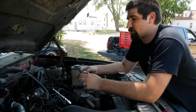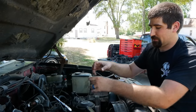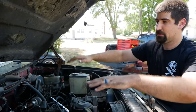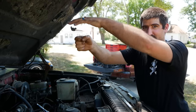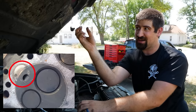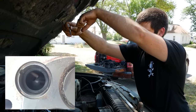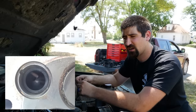The big thing on these trucks, the reason they require glow plugs, even in 90 degree temperatures, is there's a pre-cup that sits just above the chamber. They're not like a traditional engine with a piston and combustion chamber. They are piston, cylinder head, and then there's a hole drilled in the cylinder head where a combustion cup is pressed in and a little hole sits. You'll put the tip of your glow plug in and have your injector shooting right beside that heated element on startup to help heat that air.